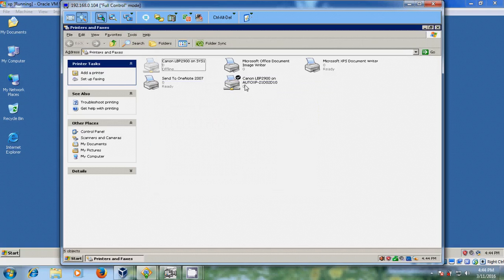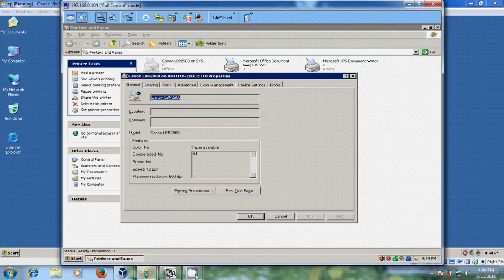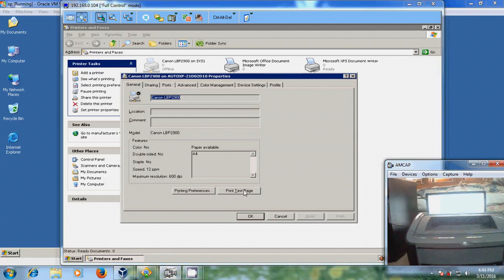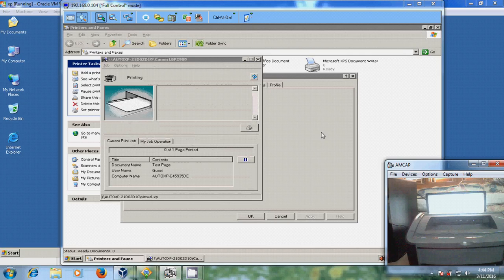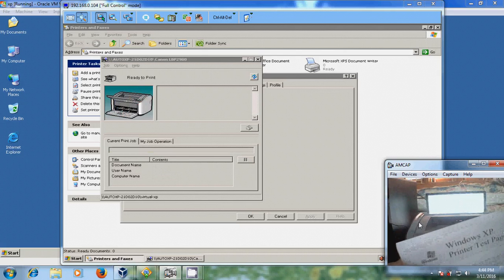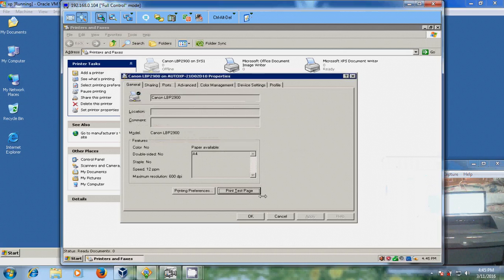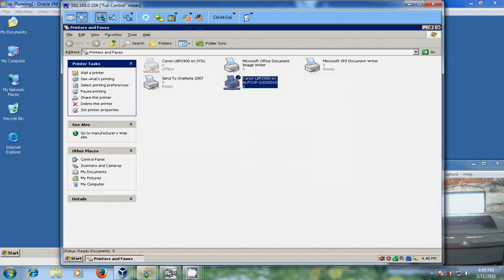Finish. Now I got the Canon printer from the XP running on VirtualBox. Let's try printing. Come to Properties — there you will find 'Print Test Page'. Now just click on print test page. Now it is printing and here you can find printing is taking place. I just took a print of the test page. After completion of the test page, just click OK. If your test page did not print, just click Troubleshoot. With this I have successfully shared my Canon printer from the XP on VirtualBox to my desktop XP computer.